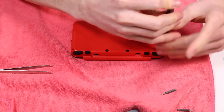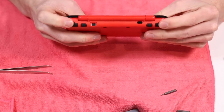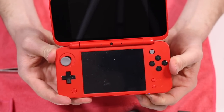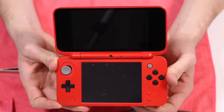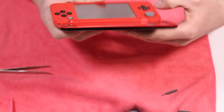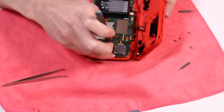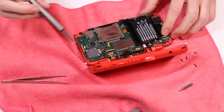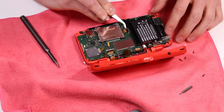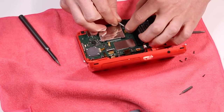This is the final straw — moment of truth. Let's flick it over. Everything looks like it's closed up absolutely fine. Oh no, that joystick's not gone back in properly — I'll sort that out in a second. Let's just try it. Does it even work? Blue light has come on. Oh my goodness — but the bottom screen's not working. There we go, that feels much better. It just went in with a bit of pressure there which means it's slotted back into place. The ribbon cable for the screen that was causing the problem just hadn't been plugged in — a very, very rookie error in my excitement to get this thing closed up. But that does mean that we now have a working 2DS XL.